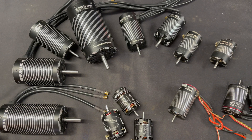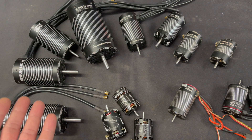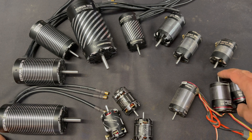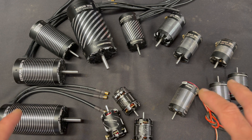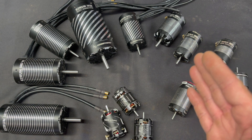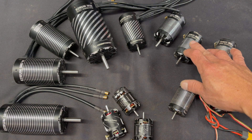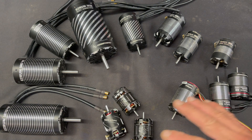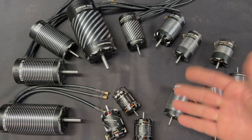Finally, the one thing we talk about often is what voltage is right. The KV of the motor and the motor specifications determine the correct voltage or S-rating of your LiPos. We run into situations where the ESC is rated for a different voltage range than the motor. A motor has a pretty specific voltage range — you can run it at its rated voltage or lower, but not higher, even if the ESC allows it. A lot of folks run a 2S 540 or 550 motor on 3S voltage and it ends very badly.